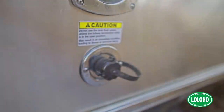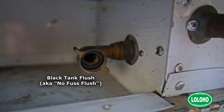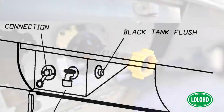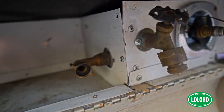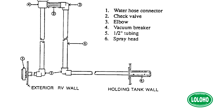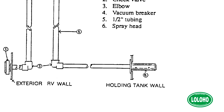There is a second freshwater inlet called the no-fuss flush or black water tank flush inlet. Quite often these inlets are located side by side on RVs and are poorly labeled, and if you are a newbie you might accidentally attach your city water to the black tank flush inlet and turn on the city water. When you do that, water flows in through some tubes and sprays the interior of your black water tank — the goal being a slightly cleaner, better functioning black tank. You really should not use your drinking water hose for this job because cooties might jump from your black water tank into your water hose.